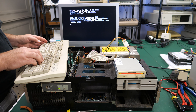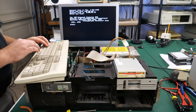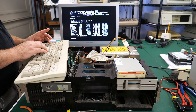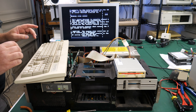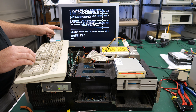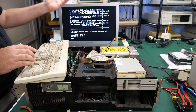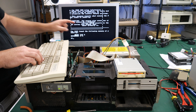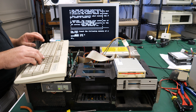New time - don't really care. And now we're in the DOS diskette. So I think there's a memory test I can run - mem size. I just want to make sure that the memory is reporting correctly. It found the following memory at power up: 512K. I just didn't know how it was going to report out whether it was going to be in bytes or in kilobytes, so it looks like it's in kilobytes.